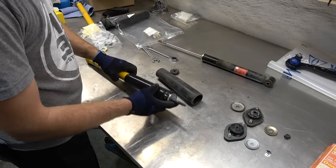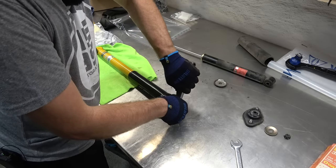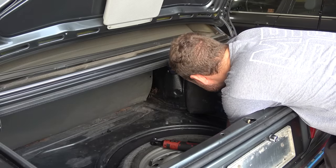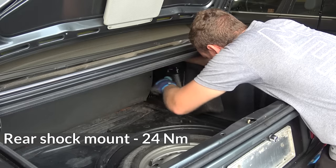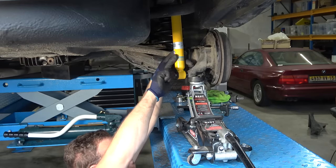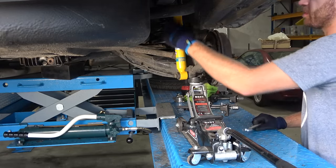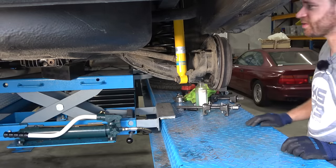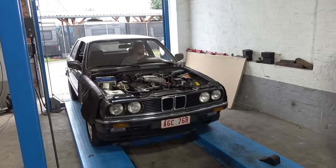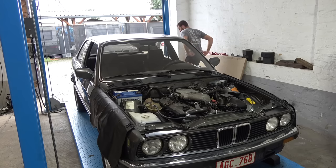Plate and bolt in — that's not going anywhere, that's a self-locking nut. My Milwaukee impact gun is holding the shock while I start the nuts — brand new ones of course. Now we need to deploy Hugh Jackman Jr. — here he is. This one we're just going to lightly tighten and then do the final torque with the car on the ground — that's what the repair manual says. Copy paste everything to the other side. Drive back and forth and then torque the lower shock bolt.